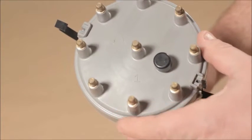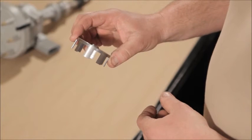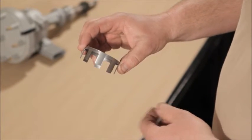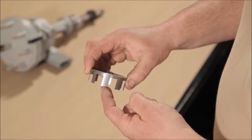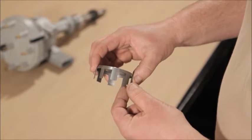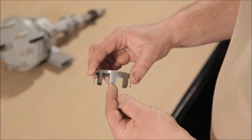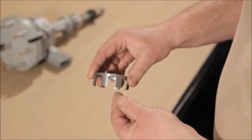The other thing about these distributors is the quality of the shutter wheel inside. This is what tells the ignition when to fire each cylinder, and if the width of the teeth on the shutter is inconsistent, so is the spark delivered to each cylinder. Most of these aftermarket shutters are well outside the acceptable tolerance, so if you actually took the time to check the advance on all 8 cylinders rather than just number 1, you'd see that there is a significant difference from one to the other. Here's something to consider.